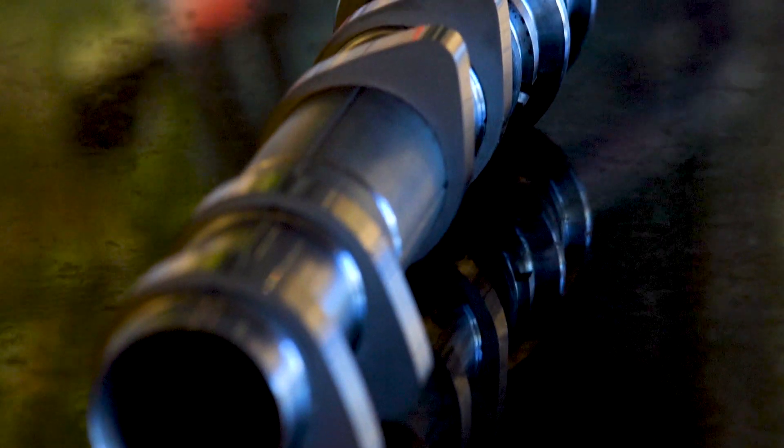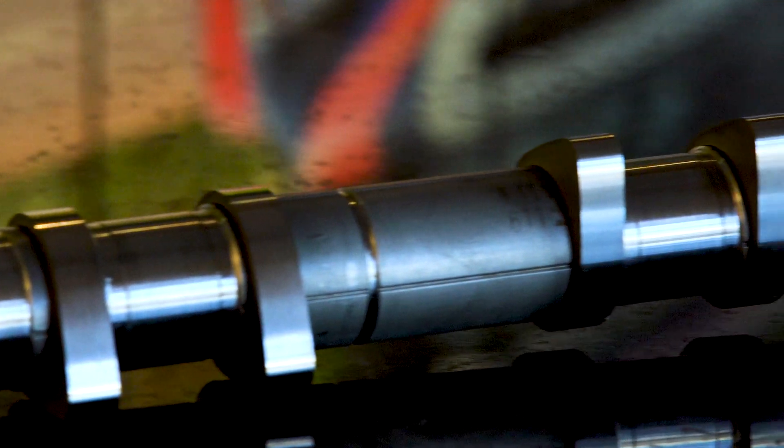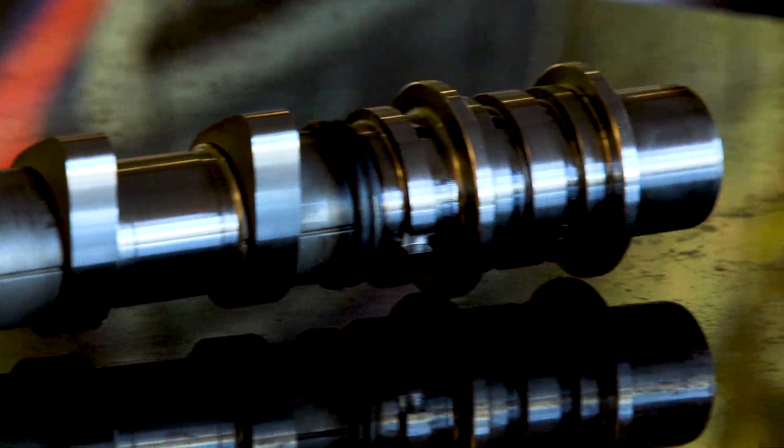It's a good question — actually a hard question to answer. Before we even go into that, we should talk about what they do. When you're talking about an aftermarket camshaft, what you're generally doing is increasing the lift — how high the valve is open every time the cam lobe comes around — and then the duration, so how long the cam is going to hold the valve open.